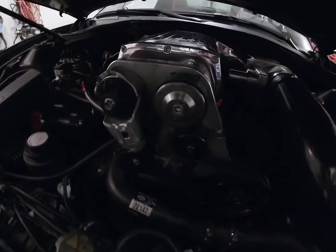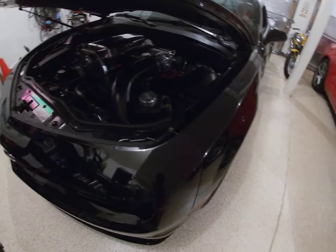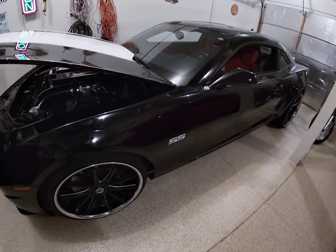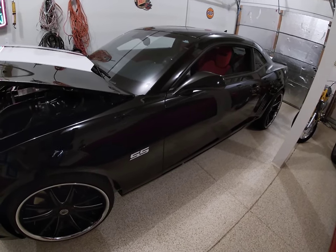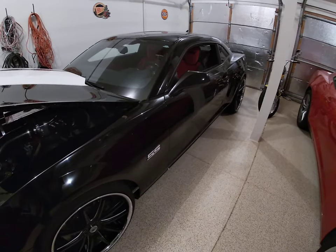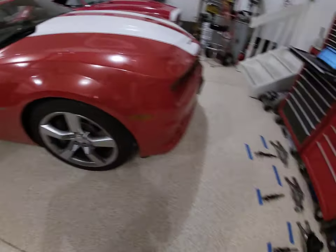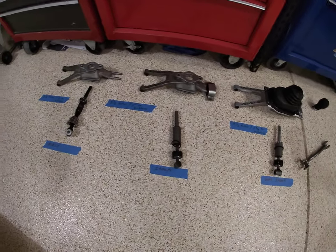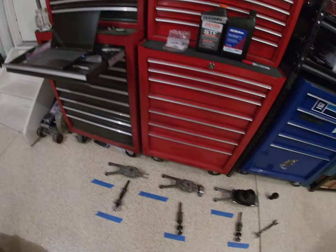When I was doing some testing with all these shifters, I did not want to hurt my engine — as you can see with the Kenne Bell on top and the good internals, there's some money invested here I don't want to re-spend. So I tried doing some things on lower engine speed power shifts — going up to maybe 2,500 to 3,000 RPM power shifting. You're not going to make any track records doing that, but if you miss a gear you're going to save yourself an engine. If you're going to try doing things with some of these shifters, I highly recommend that mentality.